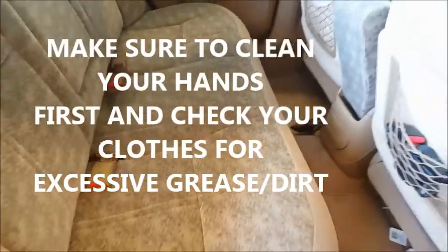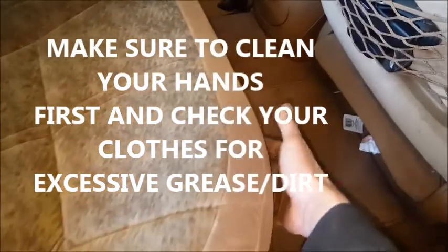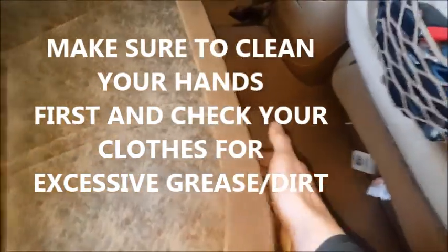All right, now that we've got the bottom all set where it needs to be, you're going to go ahead and remove these rear seats. To remove this bottom cushion, if you pull up, it won't go anywhere, but if you hit backwards and pull up, it'll pop up. So go ahead and do the same thing on the other side, and boom, that pops right out. As you can see, you've got these clips on the bottom and they're hooked on those right there. So that was pretty simple.